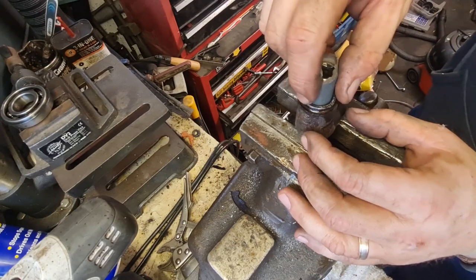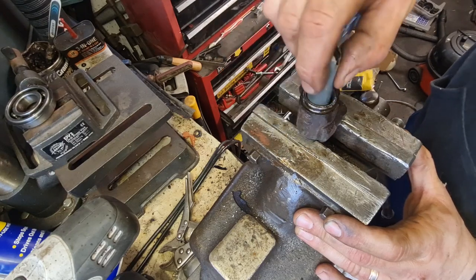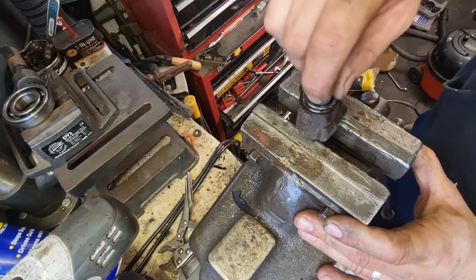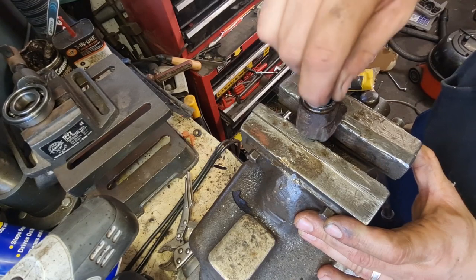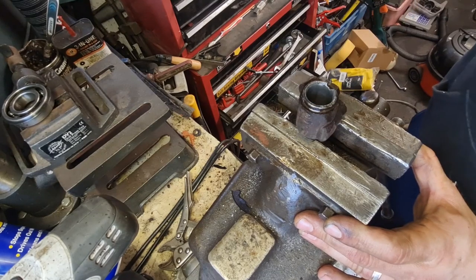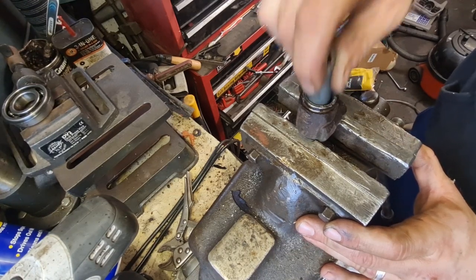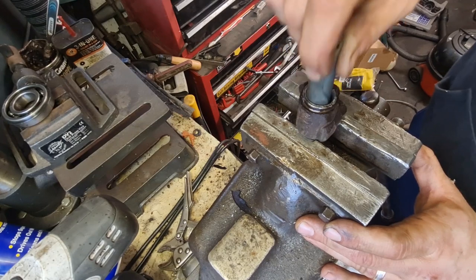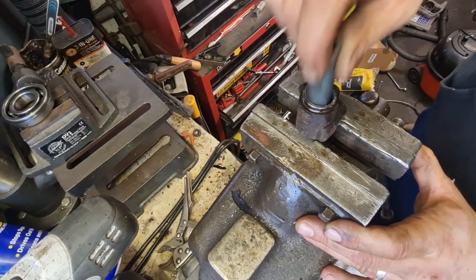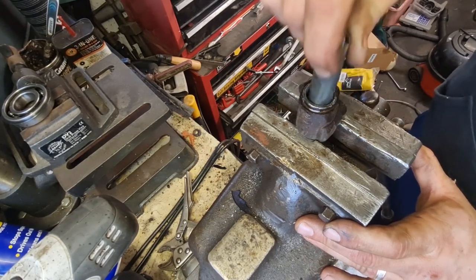This wasn't quite as smooth inside as I would have liked using the hone and the wire brush, so I've got some wet and dry and a socket. I'm just going around the inside of it with a bit of WD-40 as well and it's bringing it up absolutely brand new. I'm going to wrap all the way around and keep going - it should smooth it out nicely. There's no corrosion that I can see now. That is absolutely superb - I think we may have saved it, which is brilliant. I need to find that new rubber to go on the end of it, then we can put this back together and hopefully have a working cylinder again.